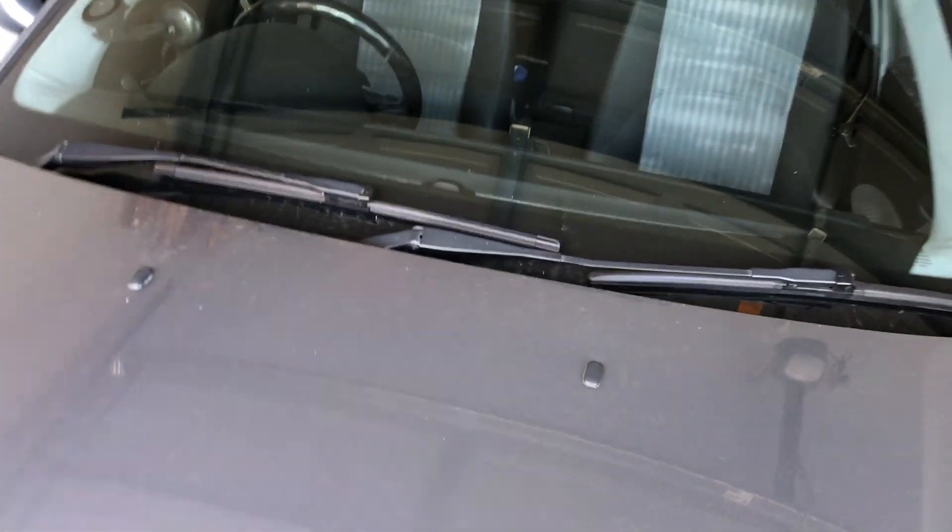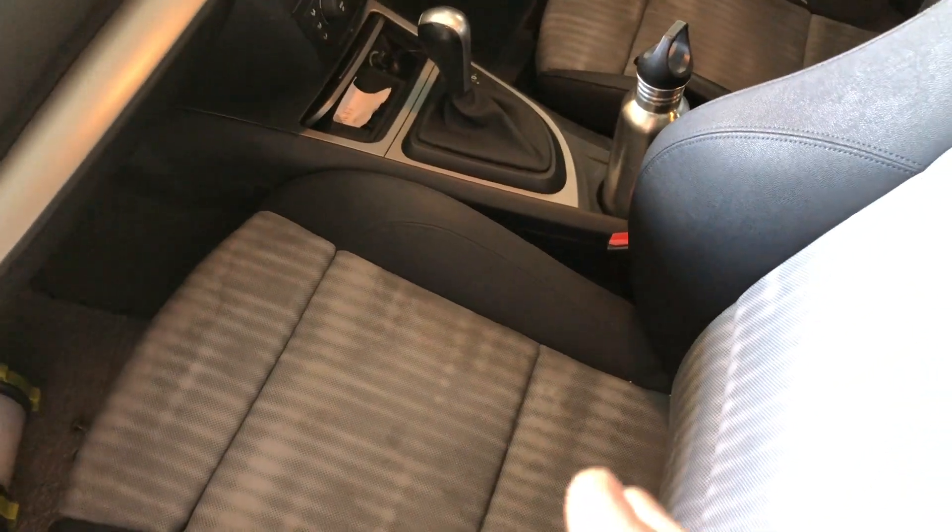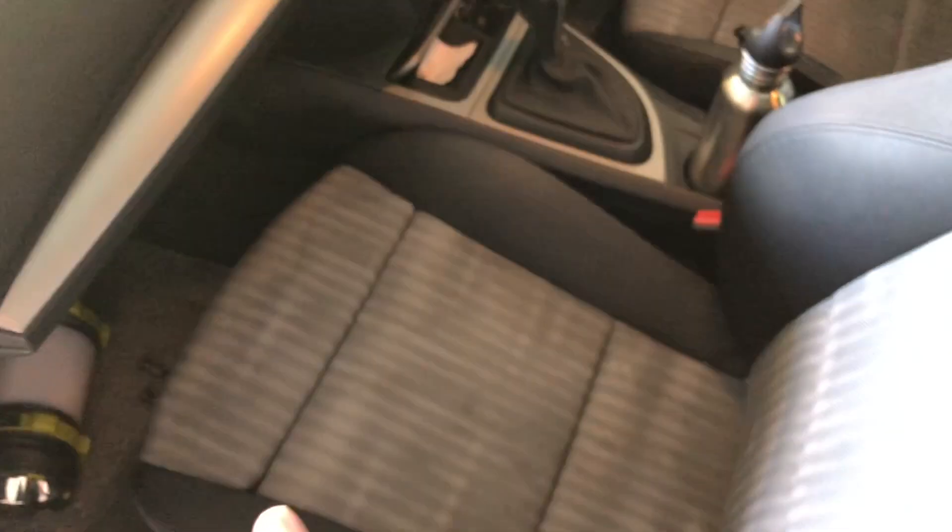But that's not the case. What I've discovered from my research is that the seat mats in the base of the seat have sensors placed right across the seat so it can tell if there's a young child sitting in there, or if there's a bag of shopping, or if there's a reverse baby seat sitting in there. It has multiple sensors - so it knows if an adult sits in it or just a little kid. Why does that matter? This airbag in the dash is really dangerous for a very young child. If someone really small is in the front and the airbag goes off, we're talking massive damage - it can even kill them. That's why the sensors are there, because even in the worst accident, if it's not detecting an adult or a heavy enough person, it won't fire that airbag. The same applies to a reverse-facing baby seat - if the airbag goes off, it's a problem, not safe at all.